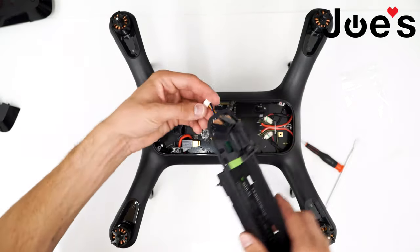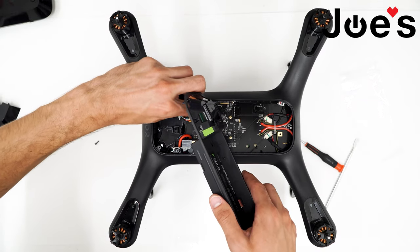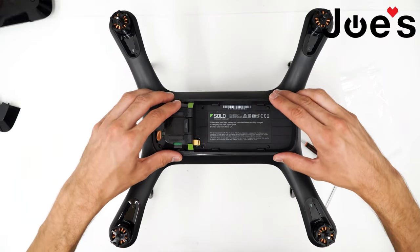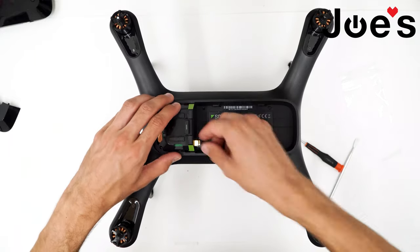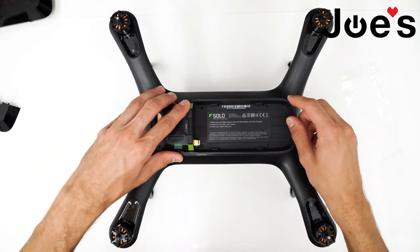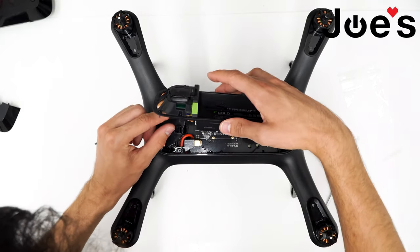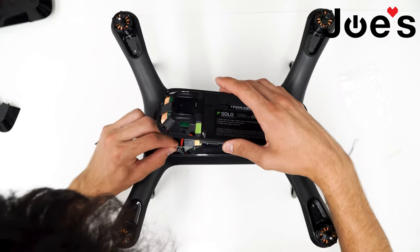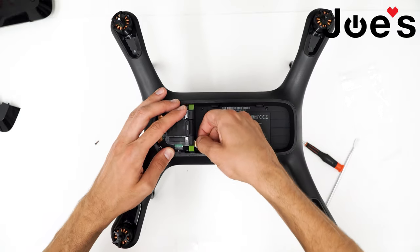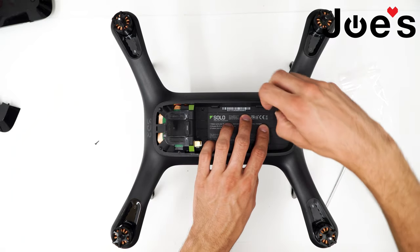We just need to put the battery tray back on. Put the clip back in place, press it in, and listen for that click. Then slide the battery tray over the terminals — you can tug up on the terminals a little bit if it's not sitting flush. There might also be a wire in the way to look out for. Now tighten all the screws back in.